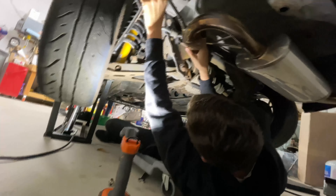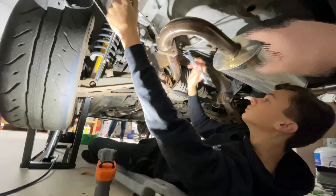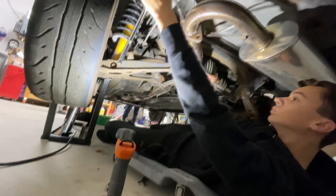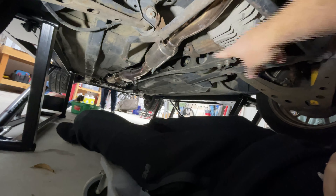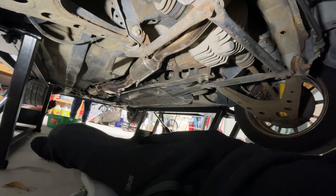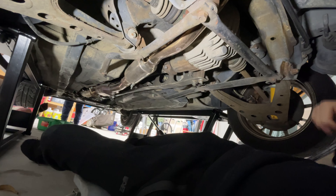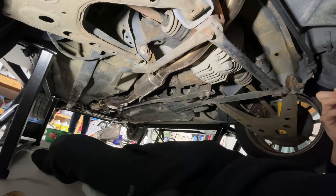Step one underneath the car — we're going to remove the exhaust, starting with the muffler, then the exhaust pieces, then the O2 sensor up in the middle. There's also a metal frame that a Miata has called a PPF — Power Plant Frame. Basically, because it's a unibody roadster, it helps stiffen the body all the way down the line of the car. We're going to take that out too just to keep it out of the way, because it's attached to the back of the transmission and the diff, and we need to disconnect those to pull the transmission.